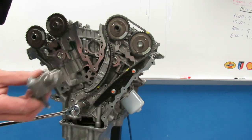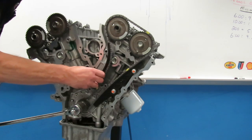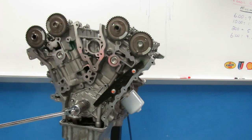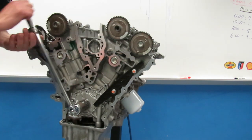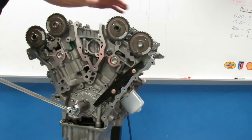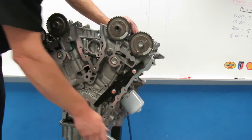There's your hydraulic tensioner and bolts. Slide this guide off the pin just like we did before, and simply remove the timing chain. Since these are in neutral, I can rotate this engine around and I'm not going to have any collisions with the valves — I know all the valves are closed. That is the procedure for removing the timing chain mechanisms from your three liter Ford training aid engine.